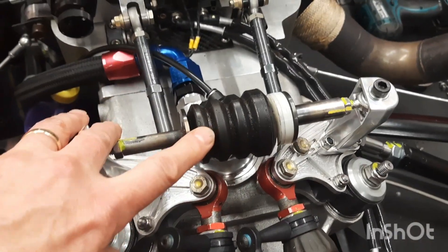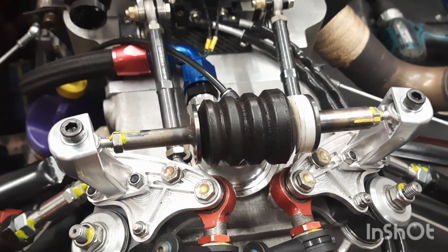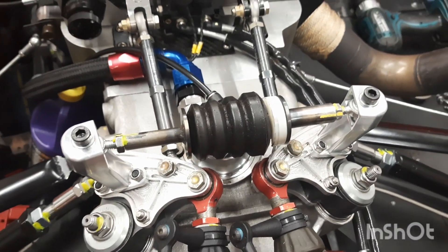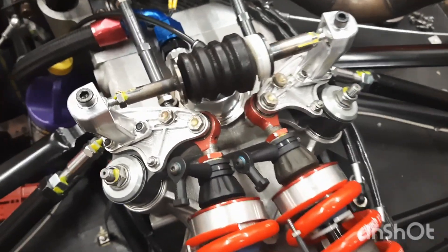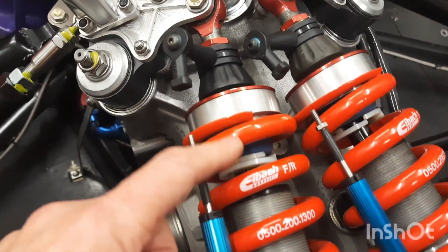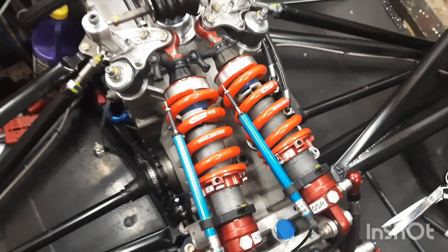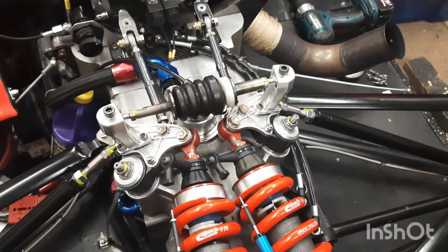The car is now sitting on the springs rather than the bump stop rubbers, and we've got the gap back. The Penske rubber is now fitted back to the telescopic shaft and I've added some plastic spacers that just clip on, to basically engage the rubber sooner. Without these spacers, the rubber would only just be touched when the dampers are fully compressed. The theory is that as downforce starts pushing the rear of the car down — this is why they're called a helper spring — it starts taking the strain and allows both dampers to continue operating without being fully compressed. That's full deflection at two centimeters, which isn't much.